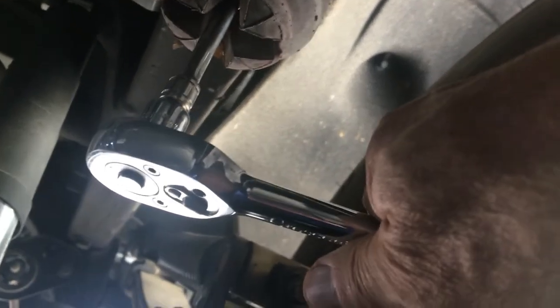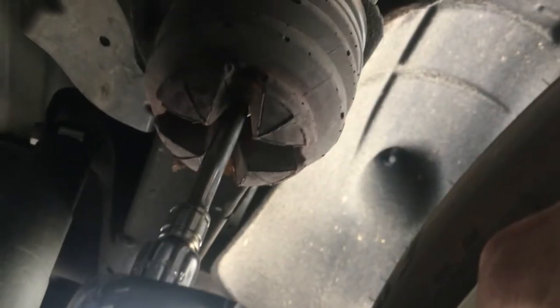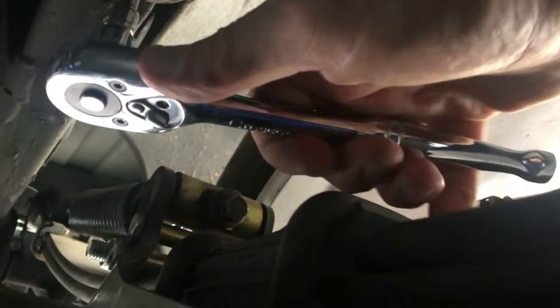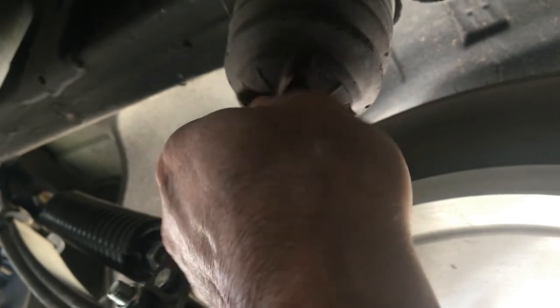On the driver's side, it's a lot easier to come in from in front of the axle because otherwise the shock absorber is really in your way. Here's the factory bump stop — this is what I was talking about, giving yourself a little space. You could see if we had no jack under there we wouldn't have any room at all. Just get on there with the 10 millimeter — it's pretty tight — and start unscrewing until you get her loose. Now we've got it all really loose.